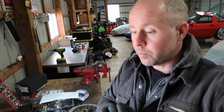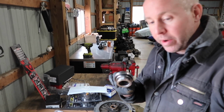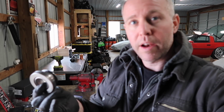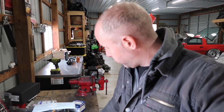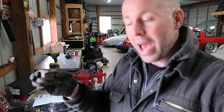Okay, one thing I want to clarify, which I'm just kind of learning now, is that the throwout bearing that I thought you needed 2 of, which I thought was really weird anyway, I just got a parts list originally and I ordered everything. So you do not use this other extra throwout bearing at all. You're going to use the one that came with the clutch kit, and then I'll show you how the clutch fork actually hooks up to this.